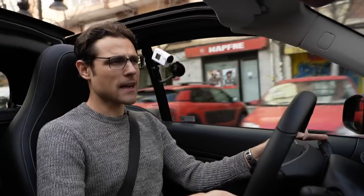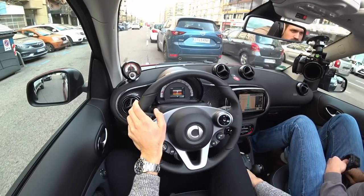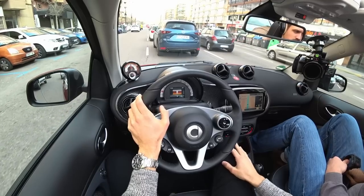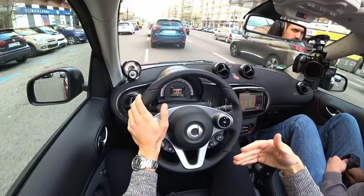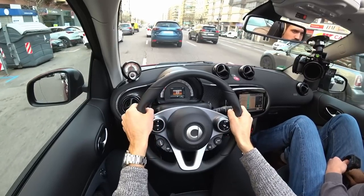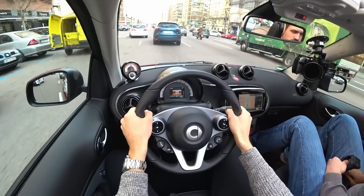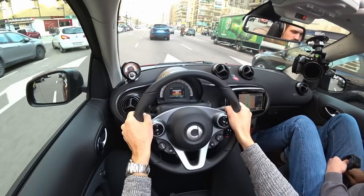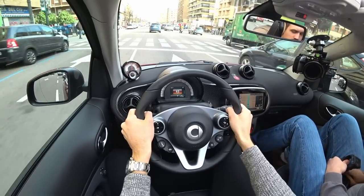And you can do that either with hitting the brakes, then first of all recuperation is being done, then if you need some more, then also the real brakes are being used. Or when you are in this eco mode, then there's more recuperation. So when I leave the throttle now, the speed is being reduced a little bit more than when we would just go in a normal mode. And yeah, I mean, why not? I think I would probably leave it in eco mode, because yes, rolling is more efficient overall theoretically.